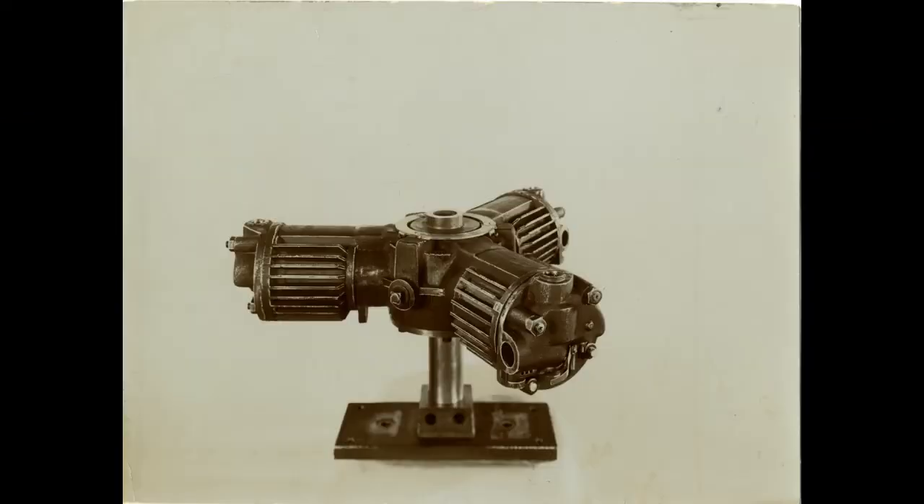In 1895, Fay Oliver Farwell became manager of the company. Farwell had an infatuation with engines ever since he saw one demonstrated at the World's Fair and began experimenting with creating an internal combustion engine for an automobile. He designed a horizontally mounted rotary engine with three cylinders. The vertically standing crankshaft was fixed in the chassis and connected to a 4-speed transmission. Farwell felt this configuration was lighter than conventional engines as it had no use for a flywheel, since the spinning engine crankcase and cylinders acted as a flywheel when running, nor had the use for a radiator because the engine cooled itself as it was spinning.